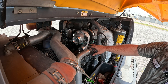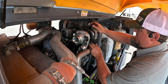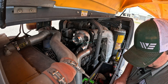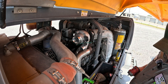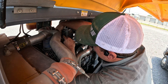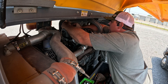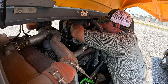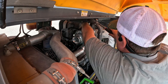We're going to put the drain tube on first — we've got the turbo drain line, it's all tied up now. Go ahead and put the pressure line in there and make sure you don't tear the O-ring. Then we've got our clamp here that holds it down, 13 millimeter on that. Go ahead and hook our wiring up here too. Hook our coolant lines up — put a little bit of grease on the O-rings as well. Put the clamp on before we install it completely. We've got a new clamp for the exhaust — there's no gasket on this one. Tighten up the clamp.